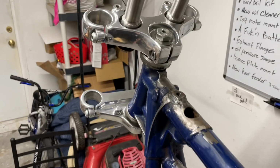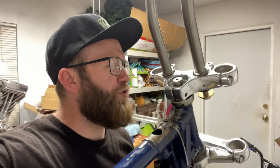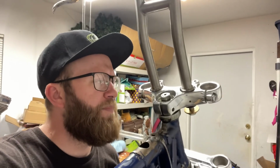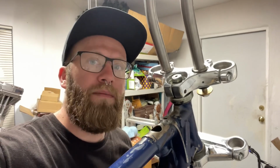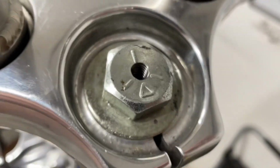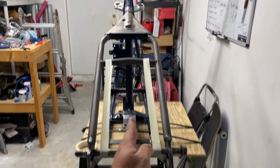So back on subject, second line of measurement. Up on your stem, you have this beautiful boy right here. This triple tree steering stem bearing adjuster locker bolt is drilled dead center with threads. So since your neck bearings are tapered, once your trees are tightened down, it is evenly center of the stem, which is evenly in the center of your neck, which if your frame is not bent, then should be the center of the backbone, leading to the center of the tail section.